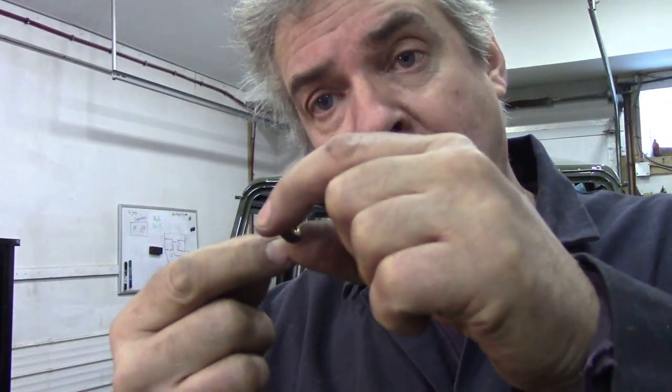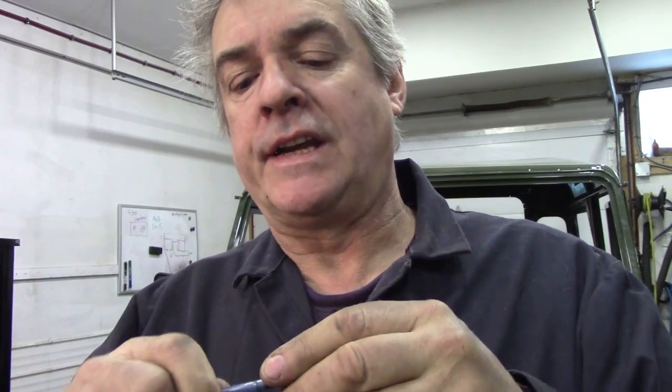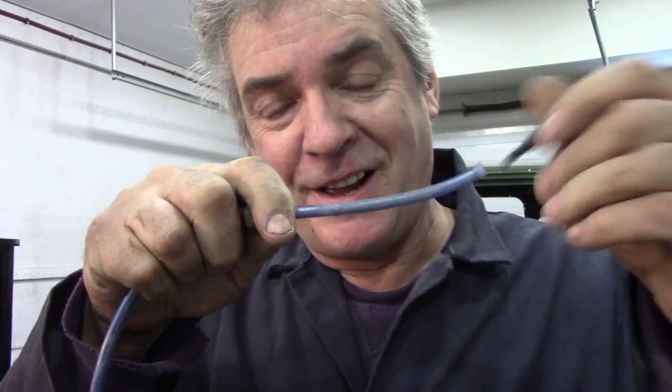Put the nut over the pipe. Alright, wait a minute, I'll show you, totally unprepared. So this is your existing pipe and your nut, like that. What you'll have done is drilled the head off, pulled that through the ashtray, taken this off, and with your new screen wash jet, get the nut, push it over the pipe, push this through the dashboard, push your pipe onto the screen wash jet, pull it back through. I know it's descriptive, but it does work.